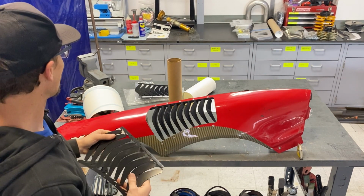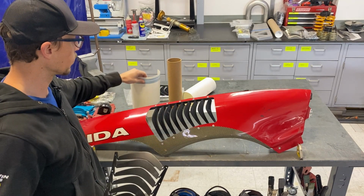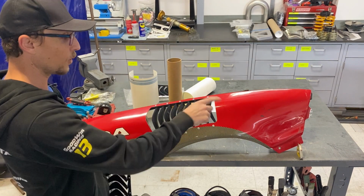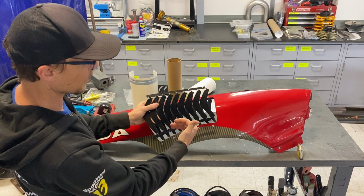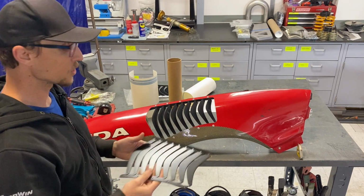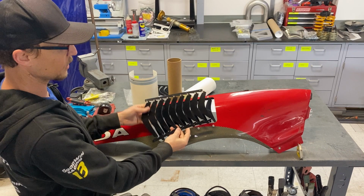We set it up that way because if we give you all of the holes in this template, as I said, that 2-dimensional template isn't going to conform to this 3-dimensional shape perfectly. So what you'd find if I gave you all of the holes in that template is that you'd drill all the holes, and then you'd line this thing up, and then the holes would be off a little bit. The top holes wouldn't be aligned with the bottom holes perfectly, and then you'd be frustrated and you've got to drill new holes, and then you've got some holes that are mess ups. We don't want that to happen. So this is your final template for where to drill your, especially your bottom holes, because those are going to align a little bit.